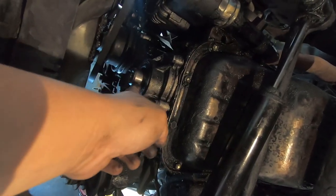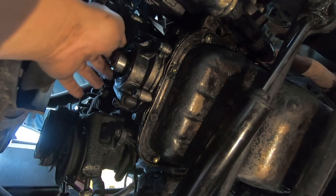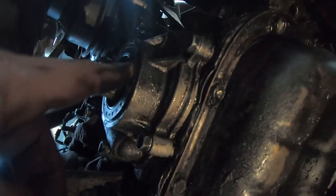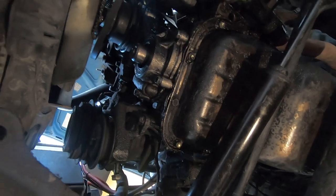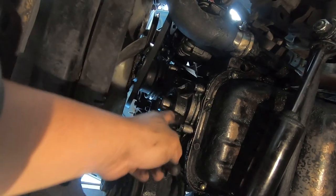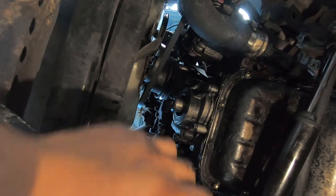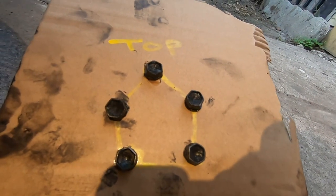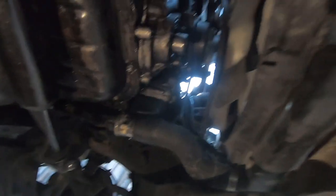This harmonic balancer can only go in one way — there's that little thing on the shaft that's keyed. The seal doesn't look like it's been installed all the way in. I'm gonna push it with my fingers and it actually moved a bit — so it wasn't sitting properly. We're just gonna go ahead and replace it. I believe these bolts are 13s or 14s and there are five of them, so make sure you keep them in order because I think there are different sizes. I'm gonna make a little cardboard template, poke holes through it, and put the bolts in. We drew the oil pump, a rough sketch, then put the bolts in the way we took them out. We have all five bolts off.